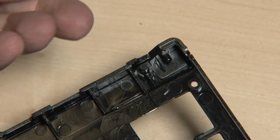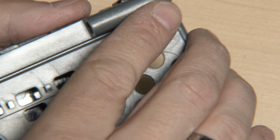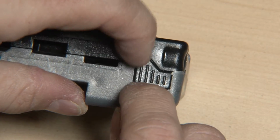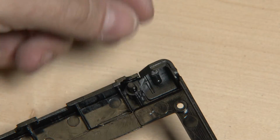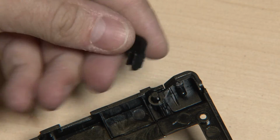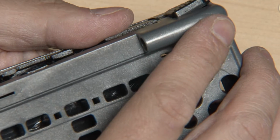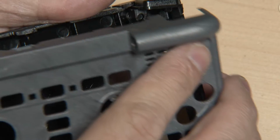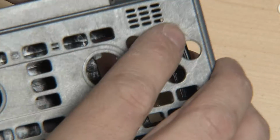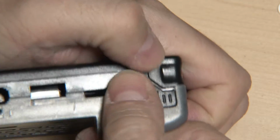That's the reason Form Action created these little rings. They will be put on here, and the shoulder button is being put on top, which of course means there's a spacer in between there, and well, the shoulder button still can move around. So yeah, that one ring is definitely not enough. So there's a second. Let's put in a third as well. So you now got 3 of these rings stacked on top. Let's put back the shoulder button, put the case together. Okay, that's too much. So let's try 2. Yeah, 2 works. Now it can't move up and down anymore, which is what should be the case.